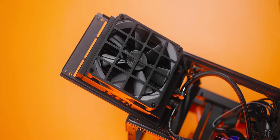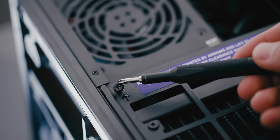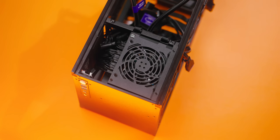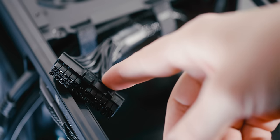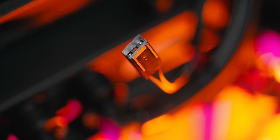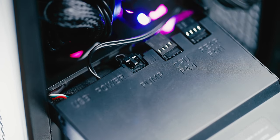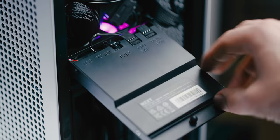The rest of the case basics remain the same, which is how this is one of the easiest ITX experiences you can enjoy. The cooler is pre-installed with clear instructions on how to fold the tubes away, plus captive screws on the bracket that holds the radiator — which is so smart. The SFX-L power supply is pre-installed with cleverly routed 24-pin and 8-pin CPU cables, so you need to do basically zero cable management, aside from plugging in the 3-pin pump TAC connector and the USB 2 plug for the fan controller. The 140mm fan is ready to go, and the 92mm fan is already plugged in as well.